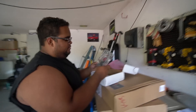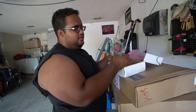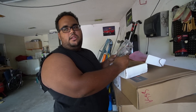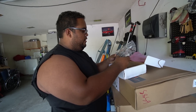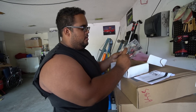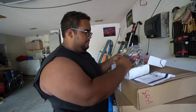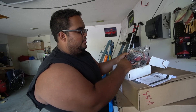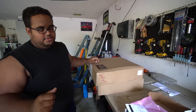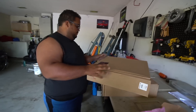This is an adjustable thermostat fan controller with the relay built in. It lets you set the temperature at which your fans turn on and off, so they're not just on with ignition — your battery doesn't die if you have key-on, and your car can actually warm up. This also has provisions for air conditioning and a manual switch. You can wire one of these wires up to the positive going to the AC clutch and it'll turn the fans on regardless of temperature, which lets you really retain all reliability and daily usability.